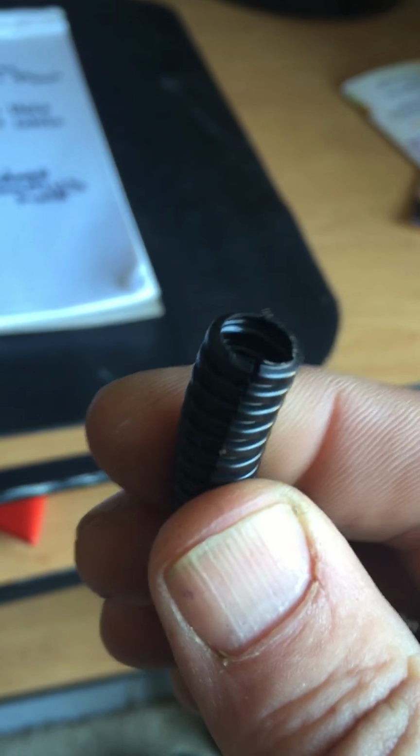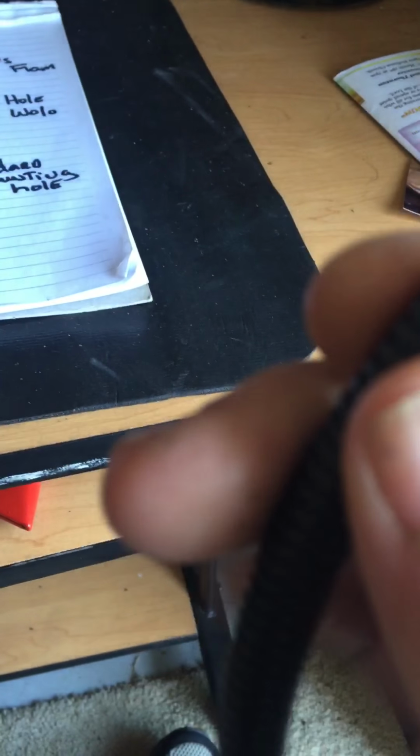I ran the wires, coming up from the horn, attaching to the horn, and going up, if you can see here, going up under the tank to the battery. Now, all I had to do was loosen up the gas tank. There's 2 bolts. You might want to get some of this, this is just a protective tubing, and I ran all 4 wires through here. This also is heat resistant, so it's going to keep things nice and tight. I don't have to worry about that.